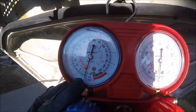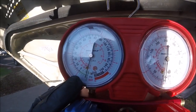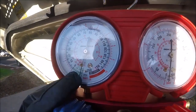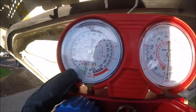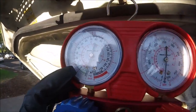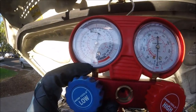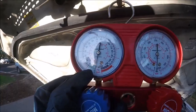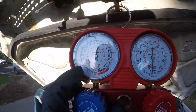If you look at the gauge it's going down to 30. It should be around 29 or 30 inches of mercury. You should be able to hold about 29 or 30, and that'll mean it's got a good vacuum. But if you can't even hold 29 to 30, that means you definitely have a big leak.